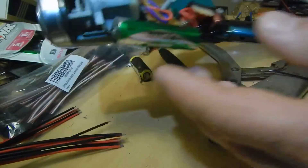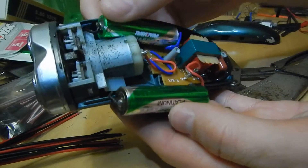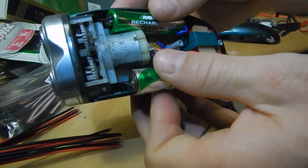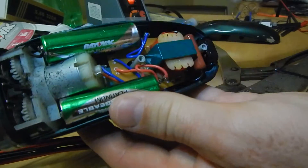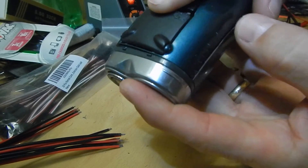So then just do that to all sides of your battery until it's all connected. Fit it back together inside your shaver, exactly how it came apart. Make sure these leads are out of the way when you put it back together because that's where the screw hole has to go. When I stuck mine back together I had to start it at an angle.